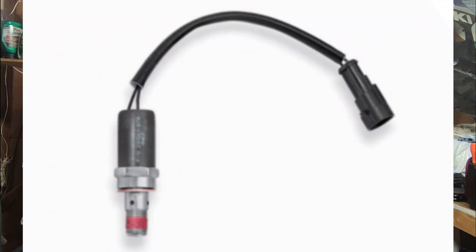So if you ride a CVO 110, or you have one of the S series twin cams and you're looking to get a little bit more power out of them or build them all the way out, compression is a great place to start with these motors. And one of the best parts about the twin cam 110 and increasing compression on these motors is that they already have automatic compression releases installed in them. Because even stock at 9.3 to 1 compression, they're still pretty hard on the starters. And then you go up in that compression to 10.5 to 1. If it didn't have the automatic compression releases, either A, you'd never get the bike started, or B, you're going to destroy the starter and tear some other things up.